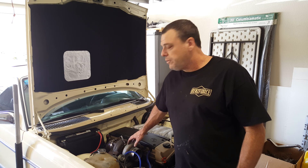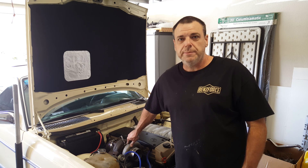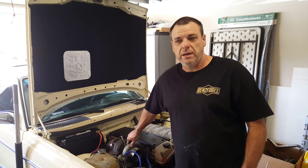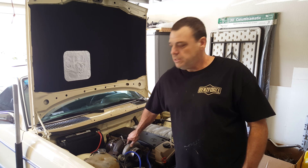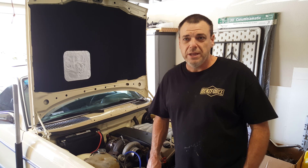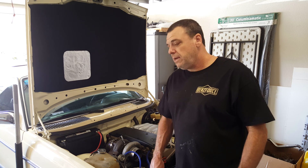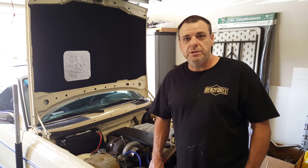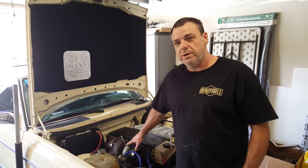I wanted to favor being on the high side so that I didn't lose the top end. The other thing that was against me was my exhaust manifold, and I knew that as well. It really comes down to how much time I'm willing to put into this, and I've kind of reached my threshold. So I'm going to use the HX35 on another project. The manifold I have no use for, and I'm going to revert back to what I know works — I had a KKD header. And my HX40 Super — that combination pulled pretty hard.